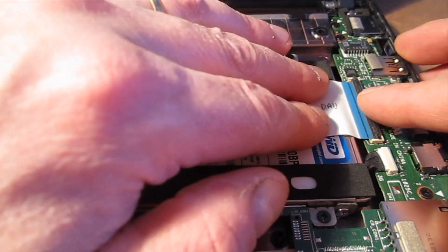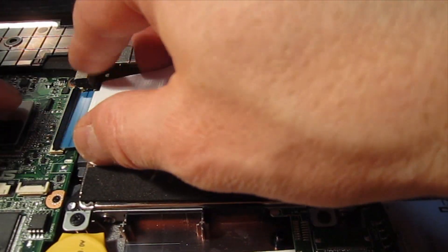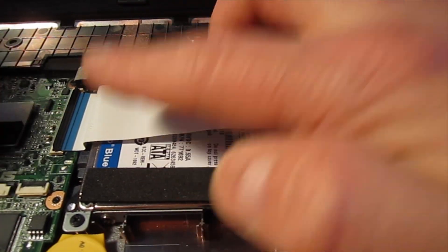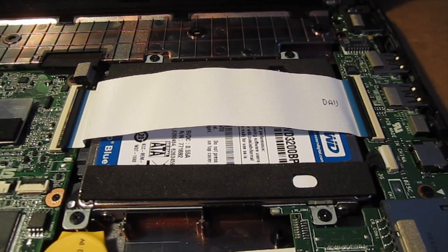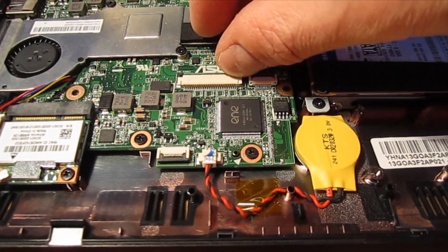You just need to make sure that it's in there and kind of snug — push that down. Same on this side and if you give it a little wiggle you'll be able to see that it slides into place. Just put a little pressure on that and flip that down. I'm going to reposition the camera and I'll show you how to install the touchpad and the keyboard ribbon cables.